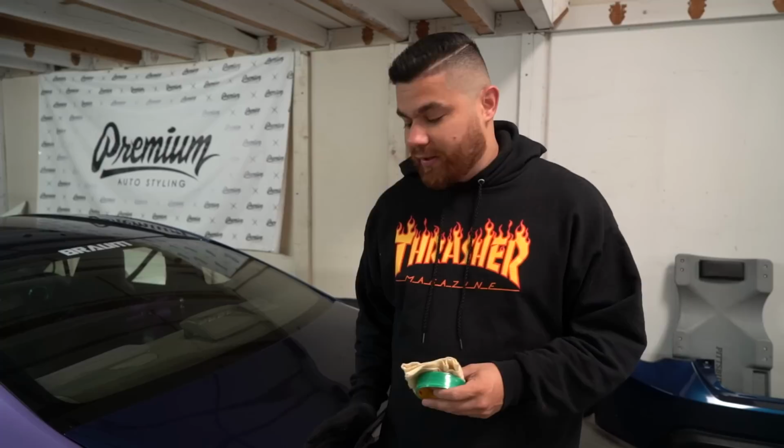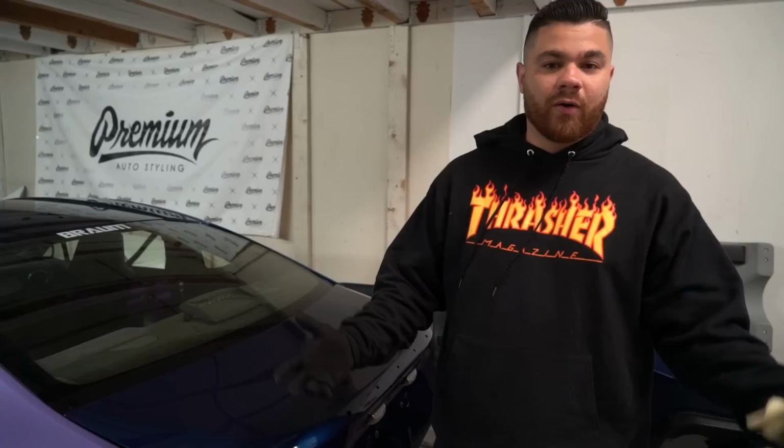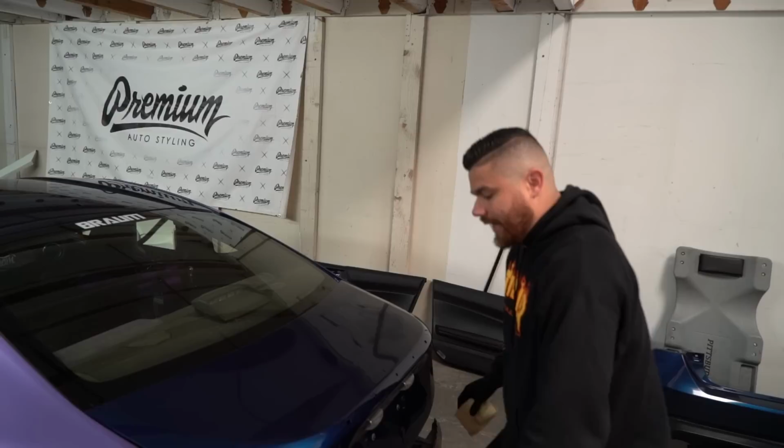The reason is we have a wing here that's gonna cover all this, and if I do it in two pieces, I can make sure that in this area the material is not discolored and not overstretched. When you're doing trunks, that does tend to happen because you have to work the material and bring it down. Of course we can do it with one piece. We've done that millions of times. It's how we do almost all trunks.